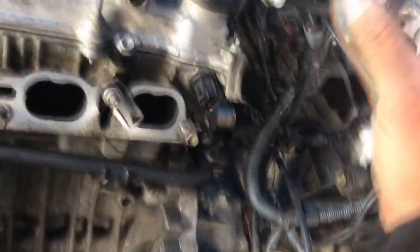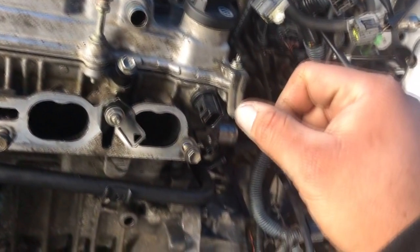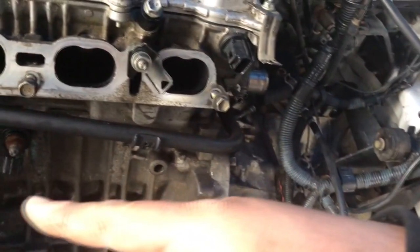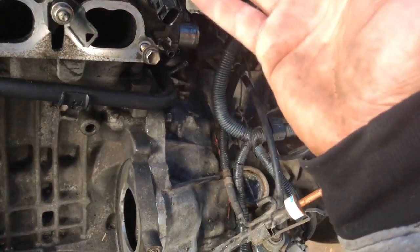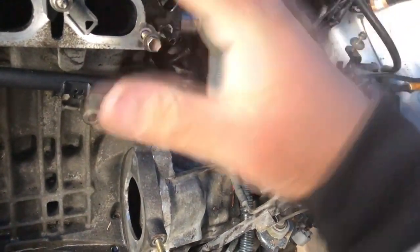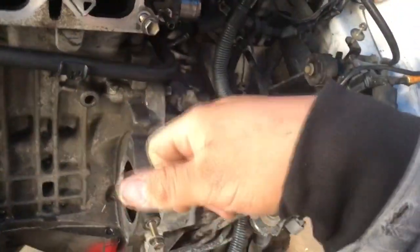So I had to put everything back on. Pretty much everything was connected. And when I tried to install my torque converter bolts, I couldn't turn the crank over by hand with a wrench. And good old friend Irvin — thank you very much — explained to me the difference of manual transmission flex plate bolts, or flywheel bolts, whatever you want to call it, from the automatic ones. They're different. I would show you guys, but they're already installed, obviously.